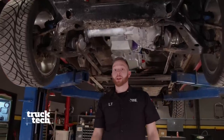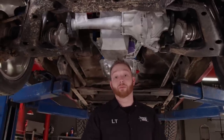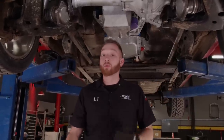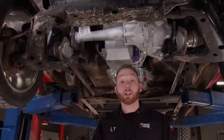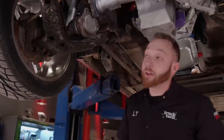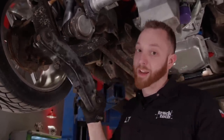The first step to converting Red Tide to all-wheel drive is getting the front differential mounted, and it's actually pretty remarkable how well this later model diff fits into this early-year truck. Both mounting points on the driver's side are in exactly the correct position — the only thing we'll have to do there is rebuild the lower mount tab that was cut off when the truck was lifted in its previous life. The flange-to-flange width of the axle and CV axle mounting dimensions are exactly the same. The only thing we have to change is the mounting bracket on the passenger side, where the boss is cast in a slightly different position.